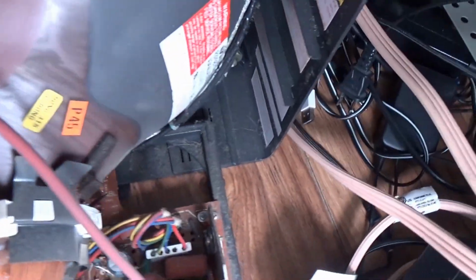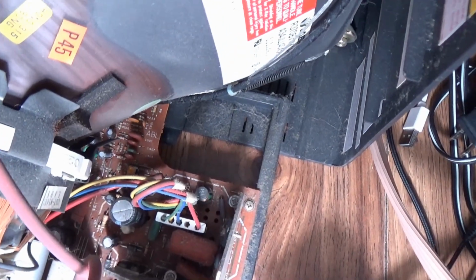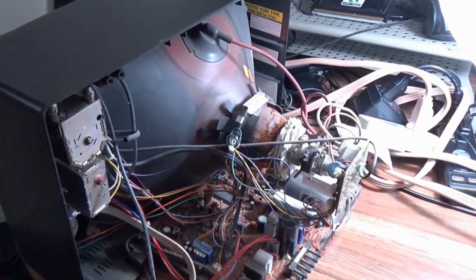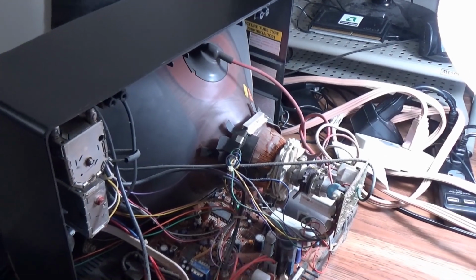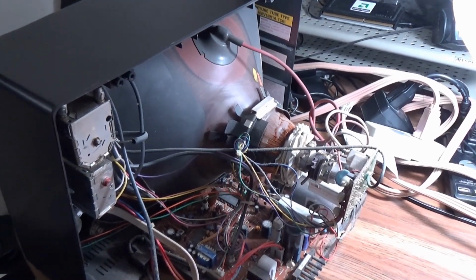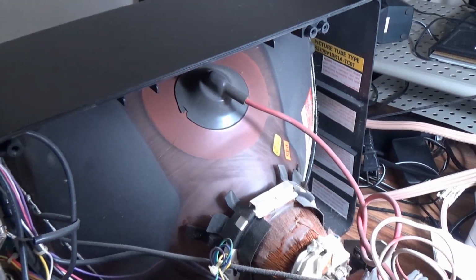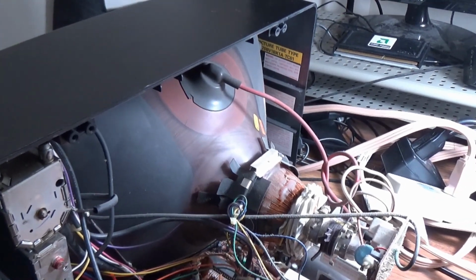That's the gain control for the tuner. That's not what we're looking for. The horizontal hold, which might be what we're looking for, is unfortunately on the more dangerous part of the motherboard. And you got to be careful with horizontal holds, because taking it too far out of spec can actually destroy parts of the TV. I don't know if I even want to proceed with this, and I have a background in technology. There's a reason why I hate CRTs and never like working with them, and it's because of all this extra crap you gotta worry about.